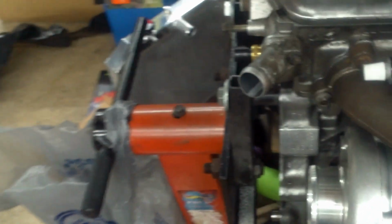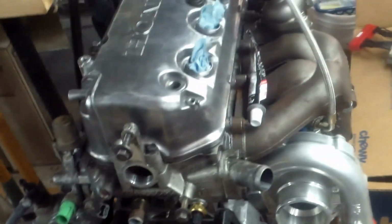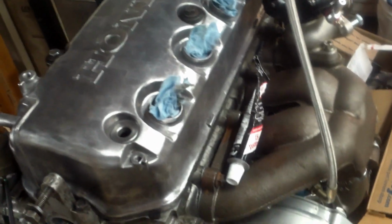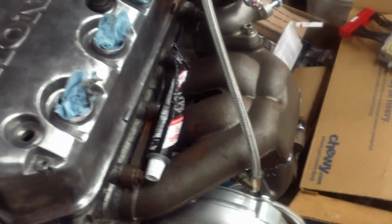So, yeah, I've got a few more radiator lines coming, some rubber hoses. I was going to go with some silicone, but in the long run, it's just better to go with the OEM rubber stuff. Trust me, if you're going to be buying silicone stuff, it's either super expensive or super cheap, and it's easier just to buy rubber. I know they don't sell kits, and it's going to be tough to find it all in one, but it is what it is. And if you do happen to find it, then by all means, send me a message or leave a comment down below and let me know where you got it, because I've been searching high and low for it.